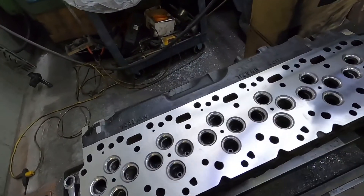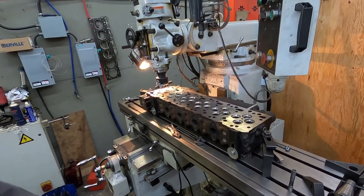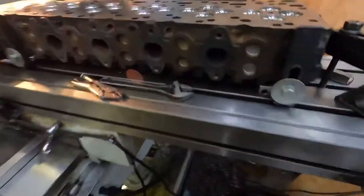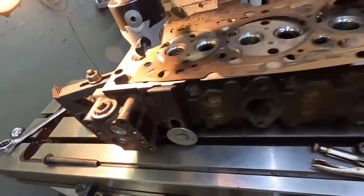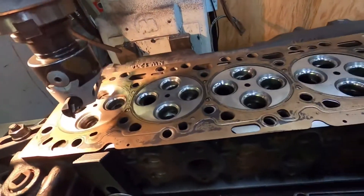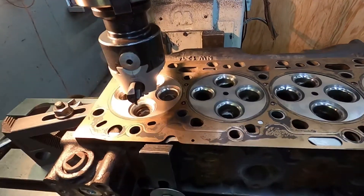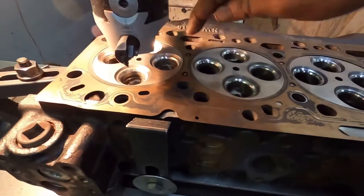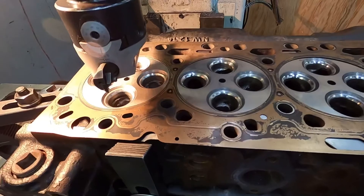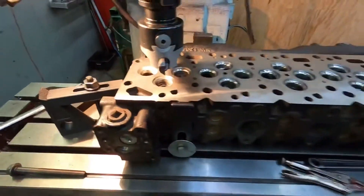We're over at the mill. What I'm going to do here is cut this head for a 6.7 gasket. I decided I'm going to use a 6.7 gasket because I've never done a 6.7 gasket on one of these. I'm going to cut the rings for 6.7 size — the diameter for a 6.7 — and then I'm going to drill the steam holes, which I've never done in a VP44 head. Hopefully we don't screw the head up doing that. I'll cut the o-rings first.